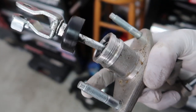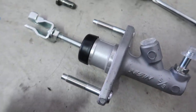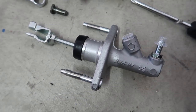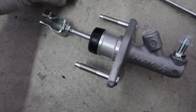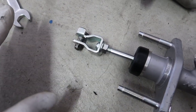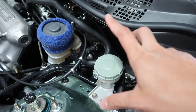The rod's broken. I decided to take off the boot from the old master — there we go, it slipped right on and fit perfectly. This old one is trash now. To put this all back in and bleed the master and slave — and like I said, quick tip: put it on the inside so it's easy to remove later on in the future.